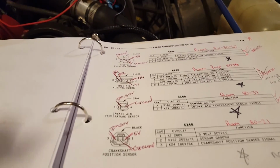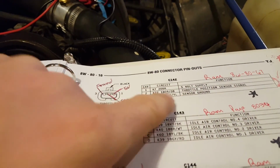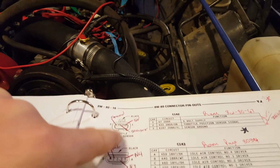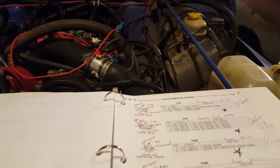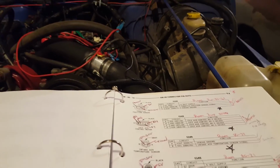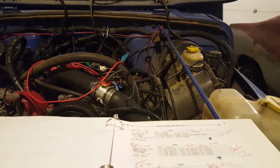Alright, go to the Jeep throttle position sensor. Number 3 is orange and yellow. That's number 3. Looking at that, we already looked at that. We know that's right. But this is the Jeep we're talking about. So I'll tell you what, the signal stays the same, so it's these two that are switched. And I bet you if I switch those right now, it clears up and does it right.